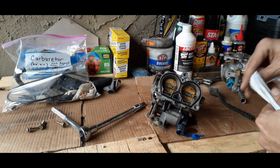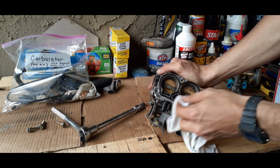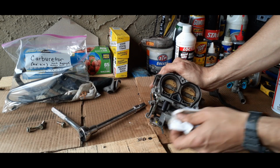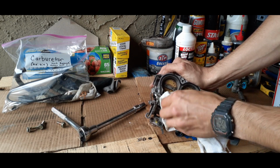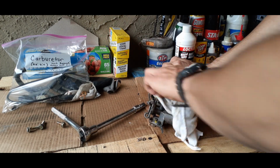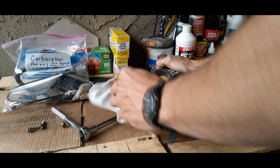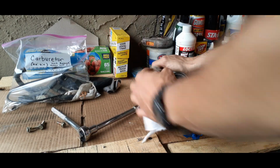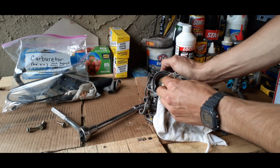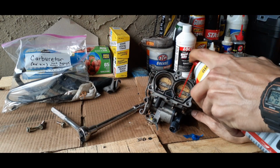And if you're cleaning a smaller carb for a dirt bike or a moped, some of them come restricted, so when you're cleaning it, you can also upgrade it or change the main jets, pilots, as well as a couple other pieces. But this carburetor is made for 1600 cc, so really not going to have to make any modifications, because we're going to have quite enough horsepower to do whatever we really need to get done. And we'll just keep cleaning.